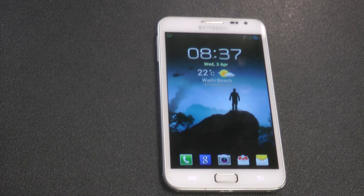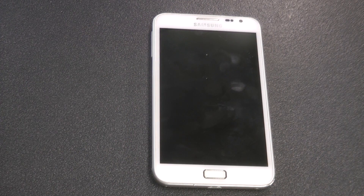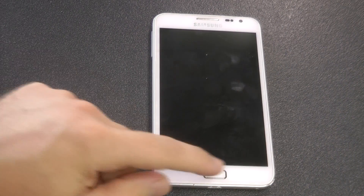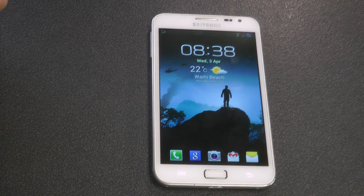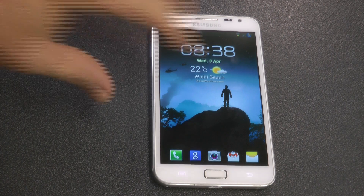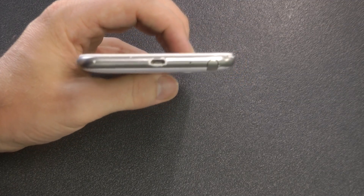That's basically all you need to do if you find your phone isn't connecting properly, or it's charging and says it's not, or vice versa — if it says it's charging and it's not plugged in, like mine has been doing. Just give that little connector a rub and make sure there's nothing in there. It could be a little bit of dust or some sort of crud packed in there — just give it a rub and make sure it's gone.